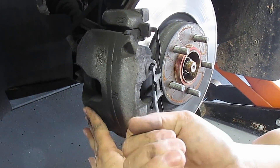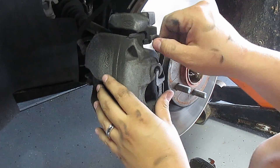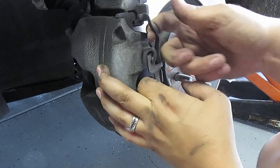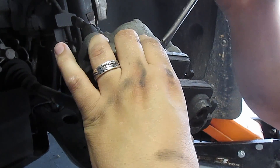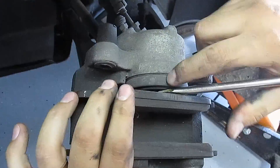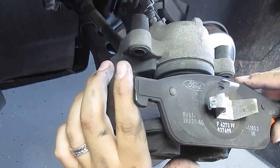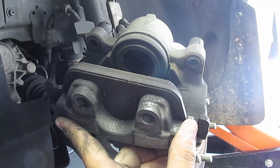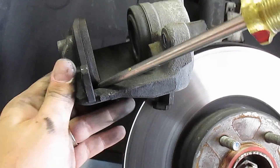Now we're going to take this clip out like so. When this is in, you have to push up here in the middle because these hook — it won't pull out until you push in and out. So you're going to pop this one out of the piston, go down to where you're on metal on metal so you don't touch this boot. Pop it out — it has that little spring that holds it in. To get this front one loose, it's probably going to be stuck, but you go ahead, stick the screwdriver in there and then pry it up. That's how I got it to come loose.